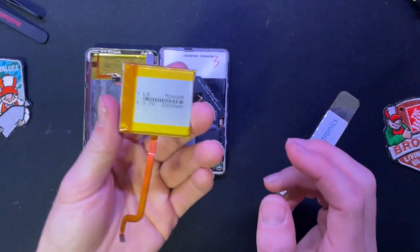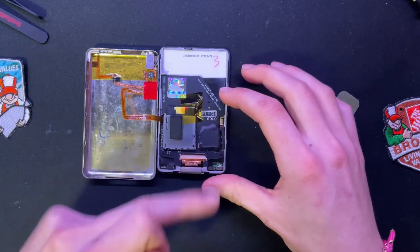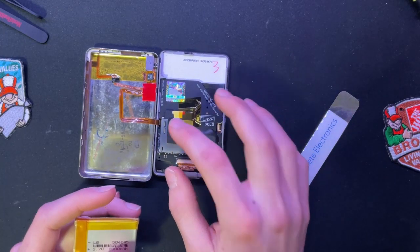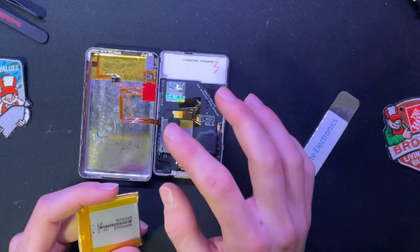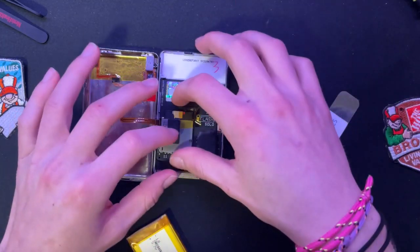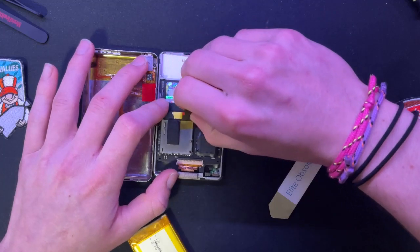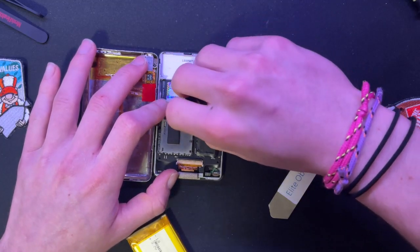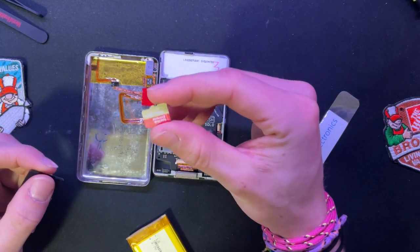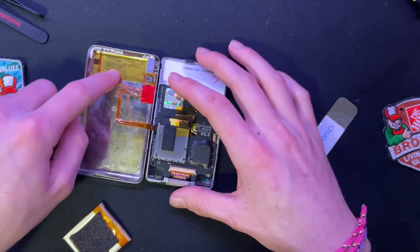And this is the 2000 milliamp hour battery. It's a square one, so it actually fits with this iFlash Solo right here. I've got 256 gigs of a SanDisk Extreme Ultra, not Plus. Plus is, or wait, no, actually, let me pop this thing out. I want to make sure that I'm right. iFlash on their website say that that one works and one doesn't. I just want to check. See, yeah, it's an Extreme, not Ultra or Plus. Extreme works. The other ones are apparently finicky.